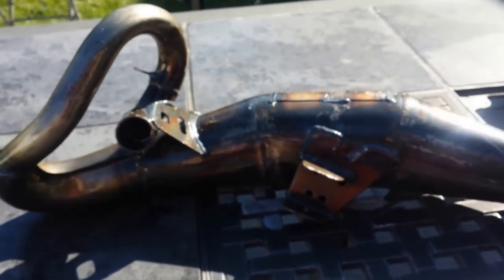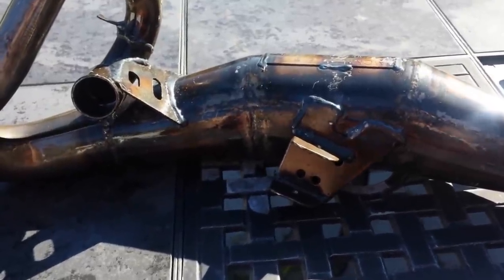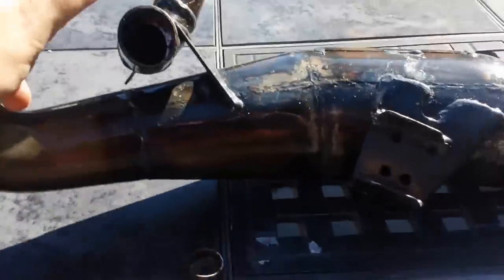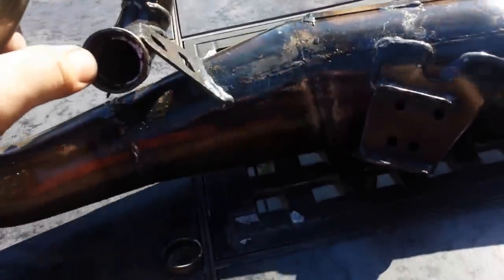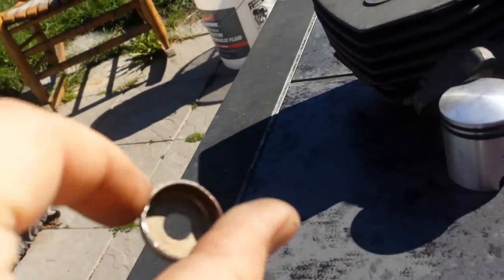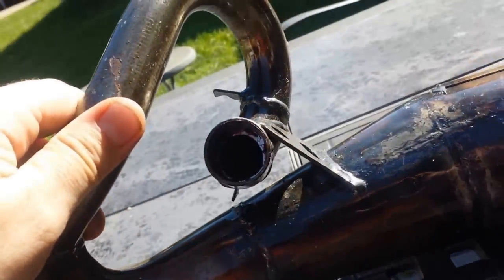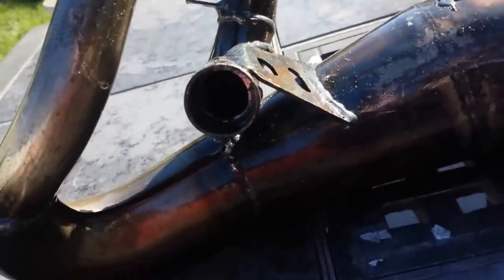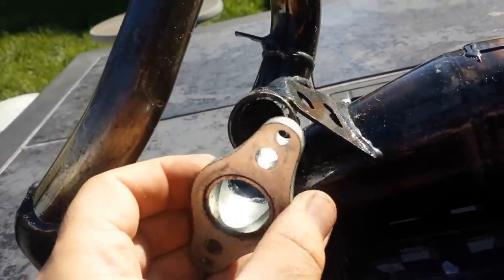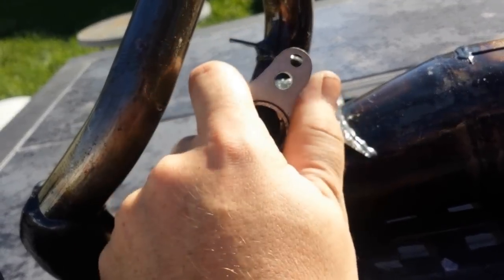This is the pipe they recommend getting with it — it's also relatively cheap, I think it's around a hundred bucks. Like most French pipes, when you first get it there is a restrictor in there. It's basically just held in with a tack weld. You can grind that out and then you're golden. I kind of had to go around the opening with a Dremel just to widen it out a little bit so the flange fits in there — it's a pretty tight fit.